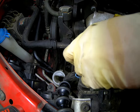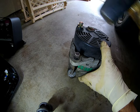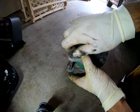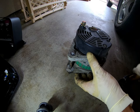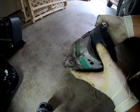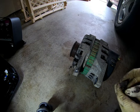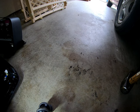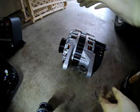The belt on this vehicle was almost tearing off. See that bolt right there — it does tend to get stuck, so you want to give it a smack. Be careful not to hit the bolt without the nut on it, because you could potentially damage the first thread. You don't have to worry about taking it out — you can simply leave that bolt in place and wiggle the alternator out. It can be troublesome, but for the most part it just slides out.